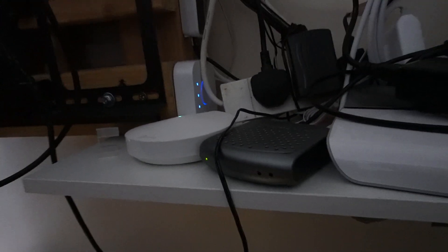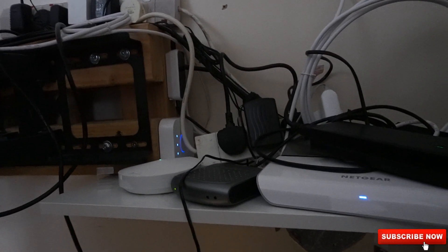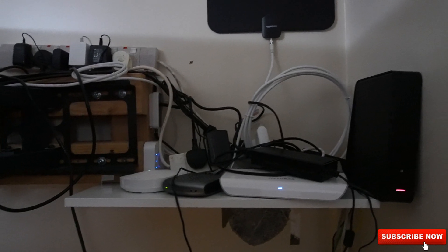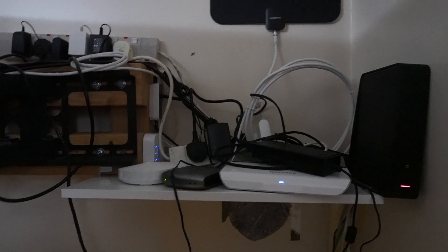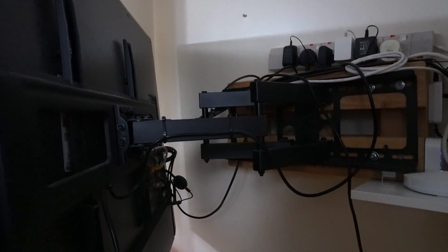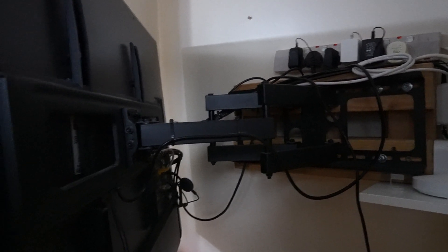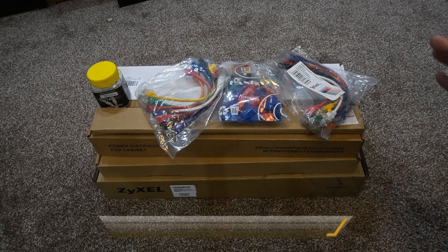So what I've done is upgraded to the TP-Link M5, which is working great. This is not the only setup I have — I've got multiple switches in different places, which are kind of a mess. So I'm going to upgrade this whole area: first I'll install a 24-port managed switch here, then right underneath I'm going to install my NAS, which is about eight terabytes. Let's go ahead with building the network rack.